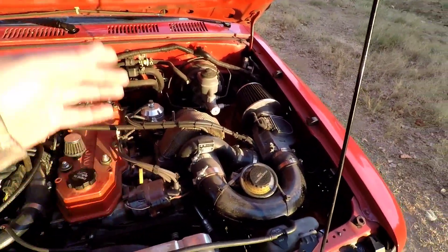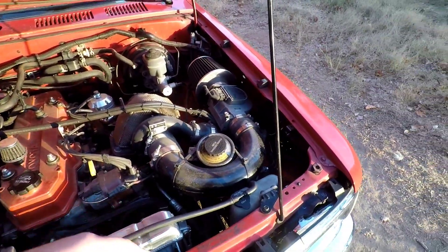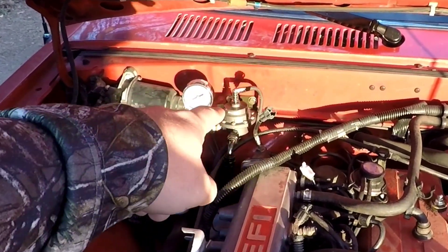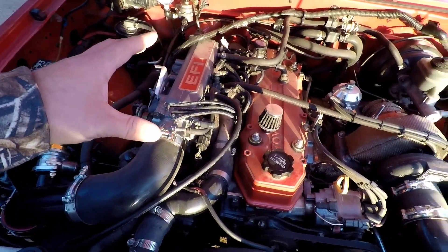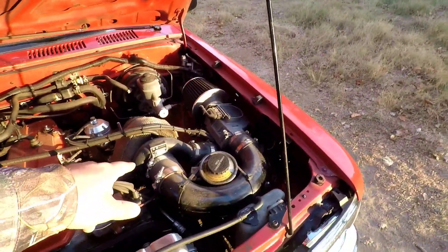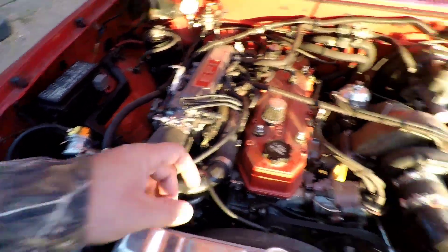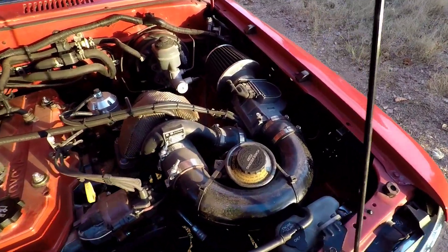When you're starting out you want your turbo, your manifold, your down pipe, and your adjustable rising rate fuel pressure regulator — very important. These are the stock injectors for now; I believe they're 200cc, correct me if I'm wrong. With this turbo you don't necessarily need a blow-off valve, bypass, or relief valve because it has an anti-surge housing, so it makes all the nice choo-choo sounds.